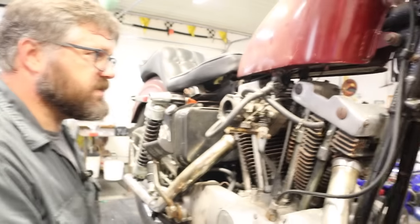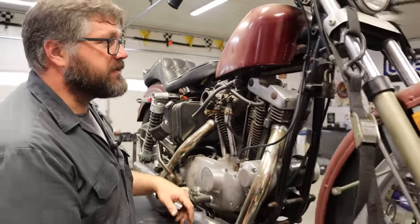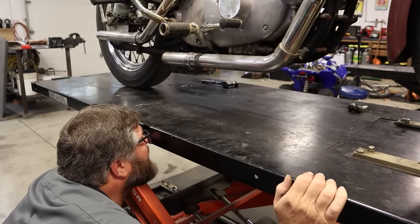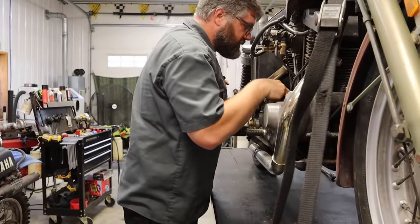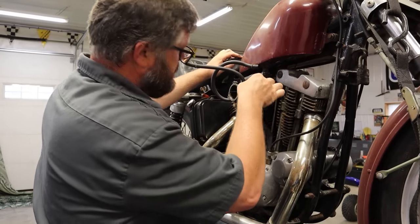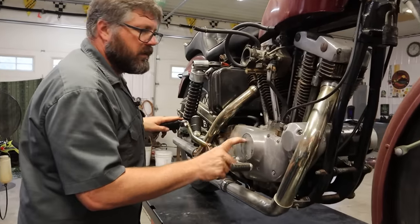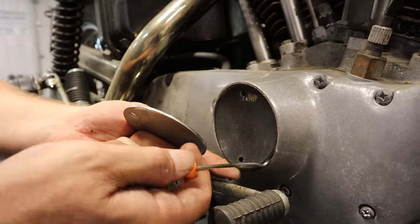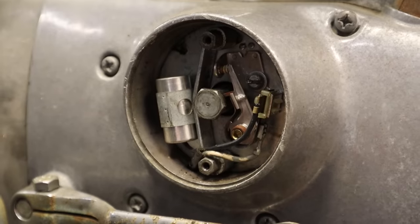These aren't impossible but they're known for being a little finicky. Hopefully we can get enough fire juice in there to get this running. I love how they put the oil pump right on the frame rail — that's outstanding. Choke — that's not doing a thing. That's like a little accelerator pump. Is that where the points would be? Let's look. Okay, look at that — we found the points. So far, easy peasy.